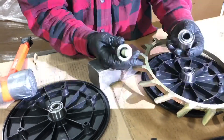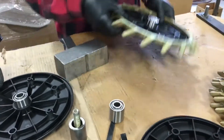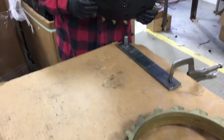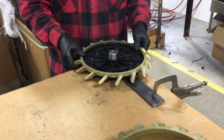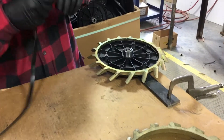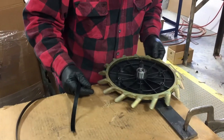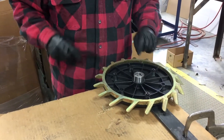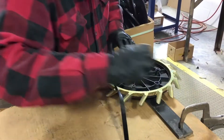We built a little race tool. Now you're ready to install — you put a flat iron, clamp it to the bench, and lay the wheel upside down. Now we're going to put a rubber in. You got to look for the egg shape just slightly, so always look for the tight spot. Pull it away and start right off the edge of that tight spot.